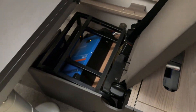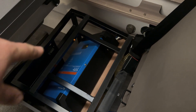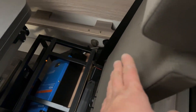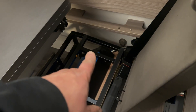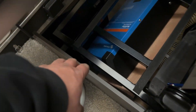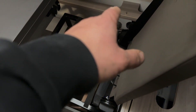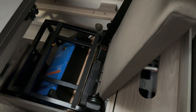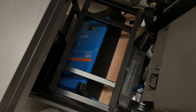Here is the spot we figured out a while ago — a great place to fit a MultiPlus 2 KVA. Under this frame, which has to stay in because it supports the bench seat or jump seat for passengers, you can't do away with it unless you replace it with something else. But if you take the frame out — it's just secured with several screws on each foot, and this board secures to it as well — it gives you access to the chassis-mounted frame for the seat belt and seat. You can then mount the MultiPlus onto that, which works really well. Plenty of space, no rattling, and it's a solid mount on dead space.